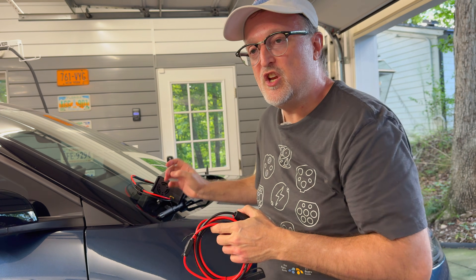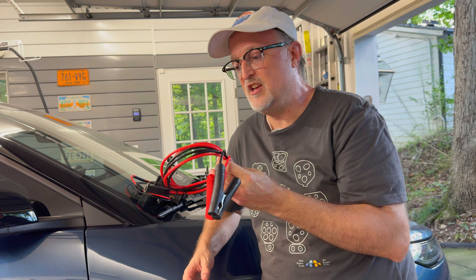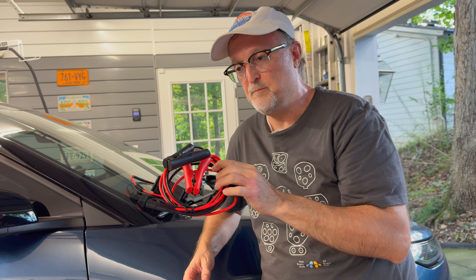I'm going to be changing the wiring that connects from that charger to the 12-volt battery directly — it's going to be a much thicker wire. And I'm also going to show wiring that can be attached to this that will allow you to jump a vehicle. So this new version of the battery tender setup will allow you to do a slow trickle charge, jumpstart the vehicle, and use a donor battery when you swap the old 12-volt battery with a new one.